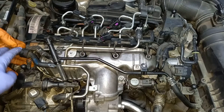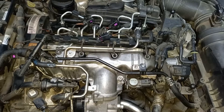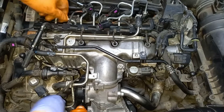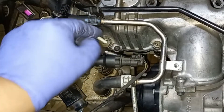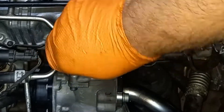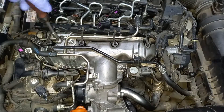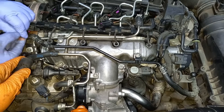One thing to mention: after putting the manifold in, you have to start with the high pressure ramp connector, which is just over here. Starting from here, we need to unscrew this screw over here and then put it right there. Do not forget about the hidden screw which is just underneath this hose.